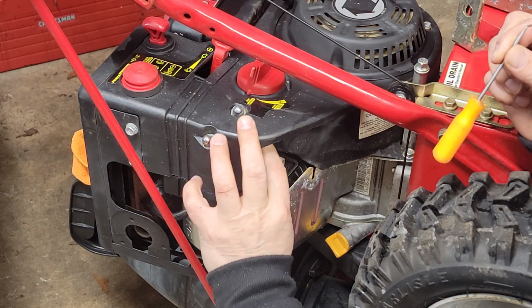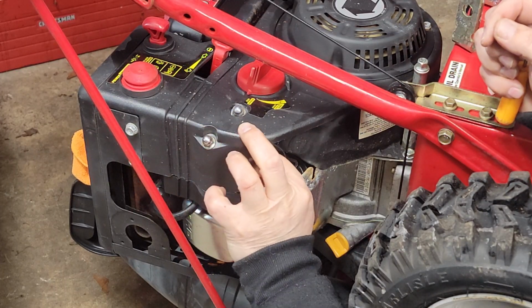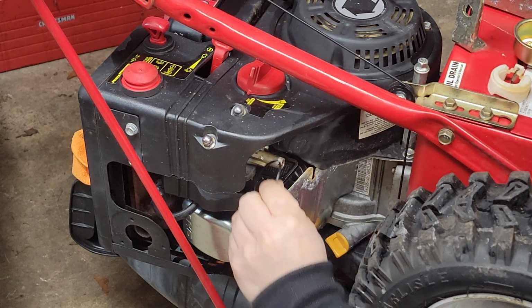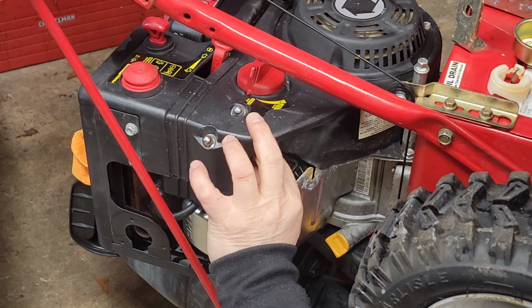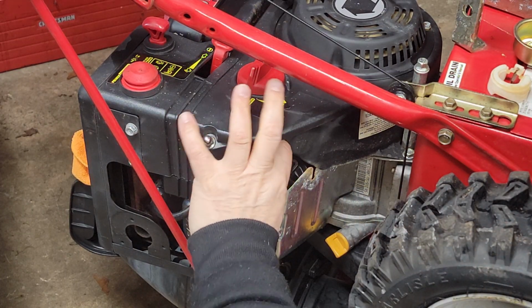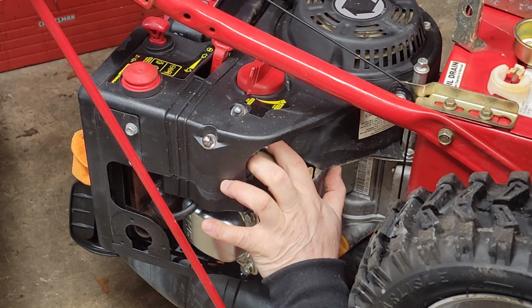The other thing too, when you leave these guys sit for a long period of time, the critters like to build nests in here. So, you know, because it's cold out, sometimes you got to stretch these a little bit. If you're not going to use these, you want to make sure you sprinkle some deterrents on there for rodents, like cinnamon or cayenne pepper. Mice don't like strong scent, so it's easier to thwart them from causing the damage than it is to deal with the damage.